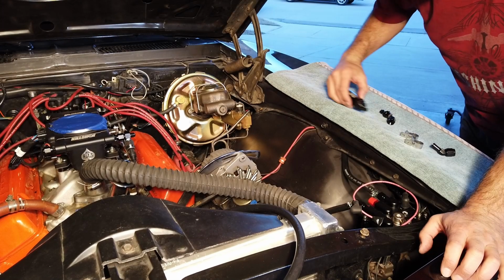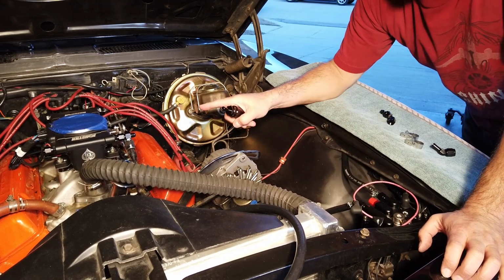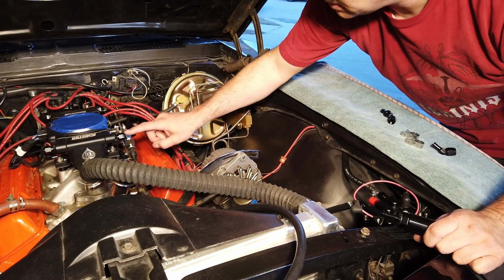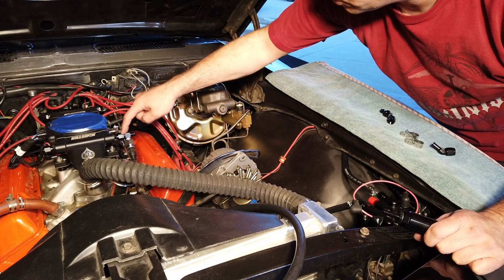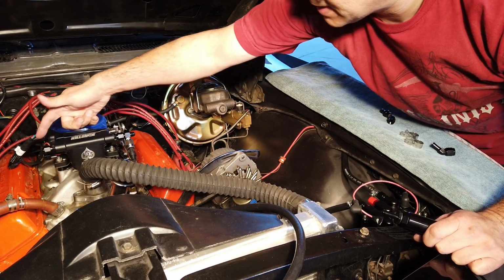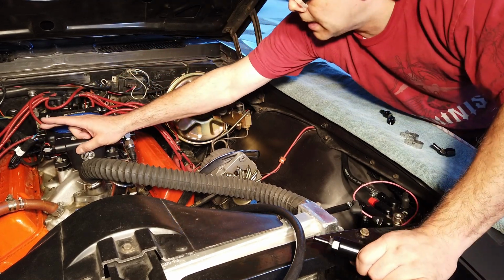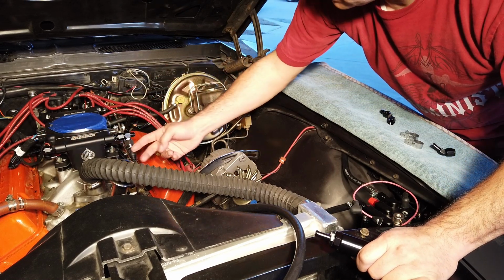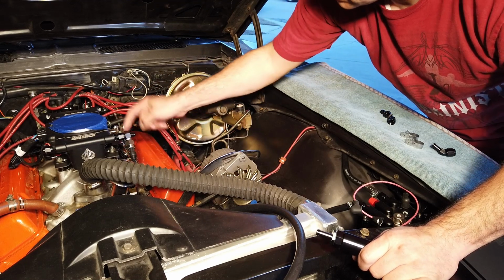So now it's time to tackle the filter installation that goes from the FiTech Mini over to the Killshot. I actually decided to change a few things around. I actually put the pressure sensor that I got as a free kit on this side, so it's all going to go in through one. The reason why I moved it from the far side is because over here, since it wasn't going to have an outlet, I was concerned that there was going to be an air pocket maybe, and then I wouldn't get very good reading, or maybe some kind of an error. So I moved it over here and sent the wire around to the back side over here. So yeah, it's nice and firm on here.